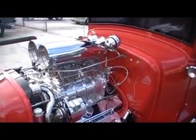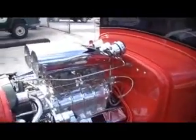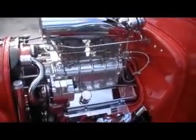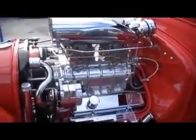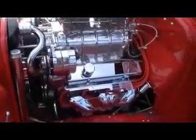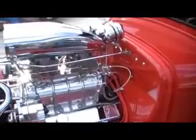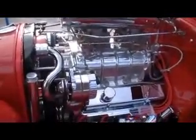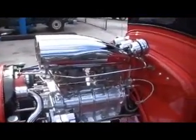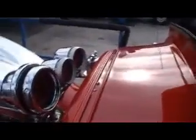Taking a look at the top — the engine is done on this 1934 Ford pickup, fully exposed with no hood. If you've got a blown small block, you've got to show it off. Very well detailed: polished 671 blower, chrome alternator, chrome valve covers, header covers, MSD ignition. It's a 355 cubic inch, 8.5 to 1 compression, 10% overdriven. It makes plenty of power for a car that's light — good torque. You can see the externally mounted gauges, which is kind of neat.